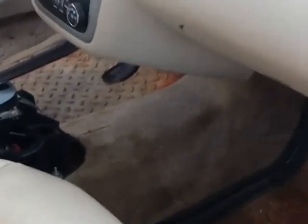Hey YouTube family, Paul Phillips — liesnot2k@gmail.com. I just wanted to show you the end result of the repair on that wiring. That harness is in; I left a long sweep of wires so there won't be as much movement in a short area causing fatigue and making them break again. I soldered them and heat-shrinked them using electronic solder, and I hot glued this down to the floor so it's not going to move. That took me about 40 minutes to do — good luck, I hope this helped.